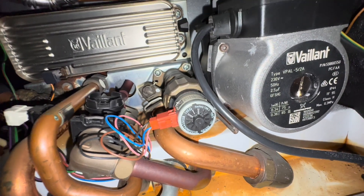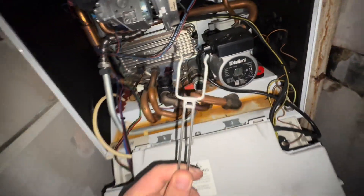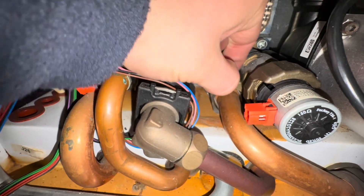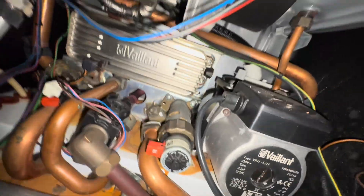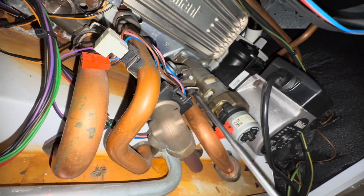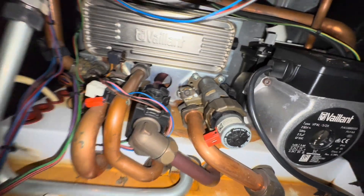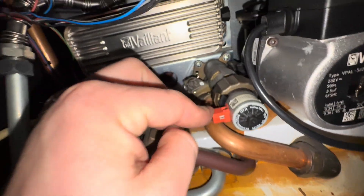In terms of the diverter valve itself, we're going to be removing this pump clip — that can go. We're going to be removing this cable and tuck it in somewhere. We're going to be removing this retaining clip. So that's pretty much it: pump clip, electrical connection, and then this clip.